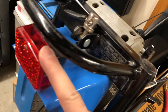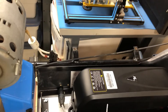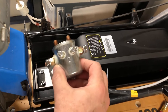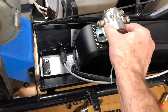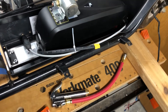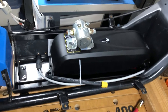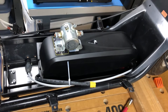That supply will probably power the rear light — which we also replaced with an LED bulb — and will likely power the contactor. I'm not sure if I'm going to use this contactor though, because it pulls about 1 amp. I'm looking at another one that I think is about 200 milliamps, but it's not really intended for this type of application. It is a DC contactor though, so we'll see.